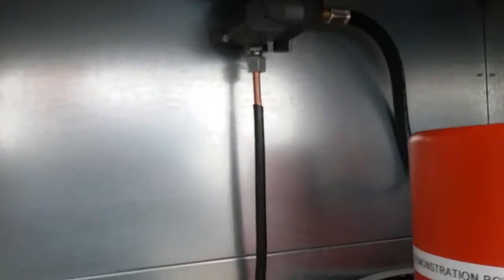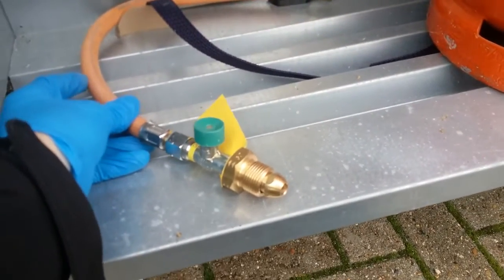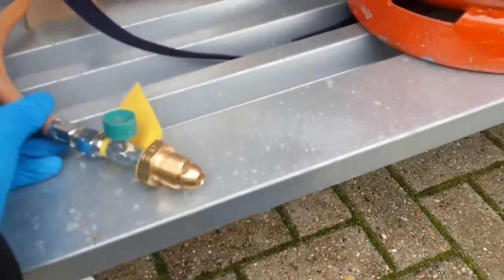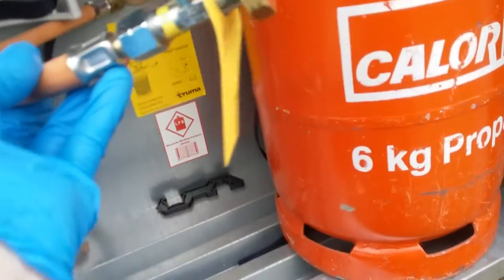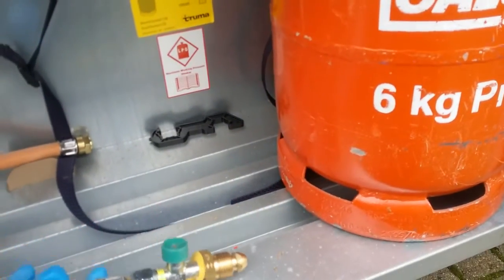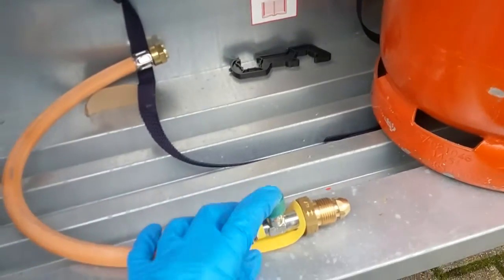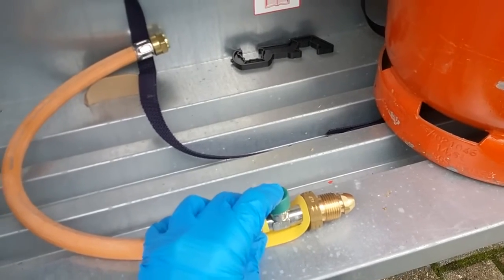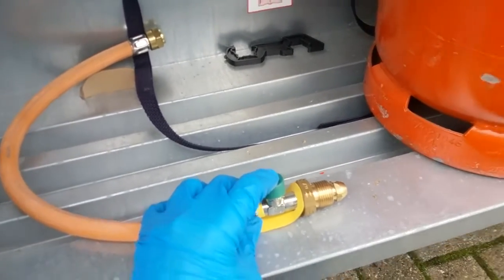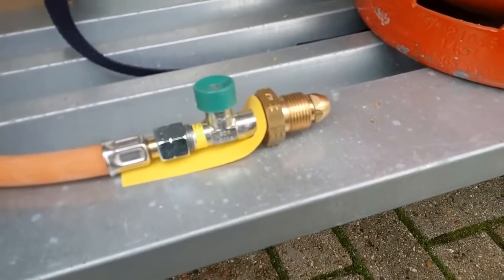This particular motorhome runs the Truma DuoSecure system. So we have the crash regulator just here, and then you're supplied with a crash safe propane hose. So once you've screwed your hose into your propane bottle, tightened it with a gas spanner, you then turn your gas on at the top, and then you will need to hold this button in for about 3 or 4 seconds to allow gas into the van. We can then leave the gas turned on even when we travel if we want to.